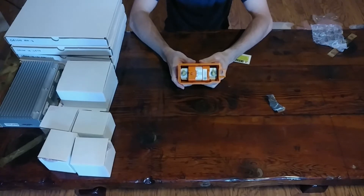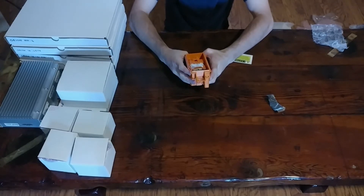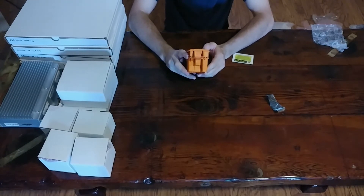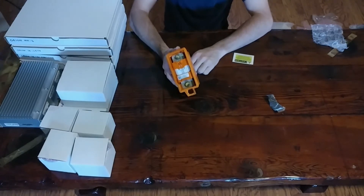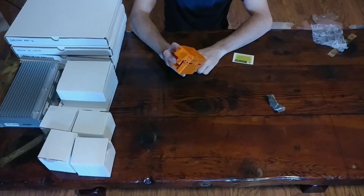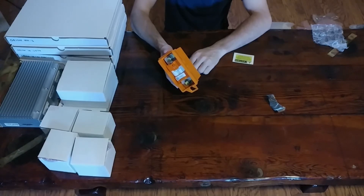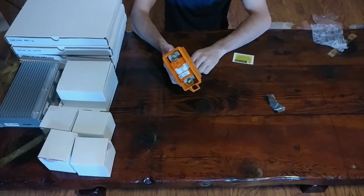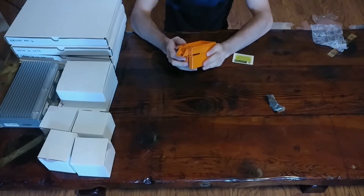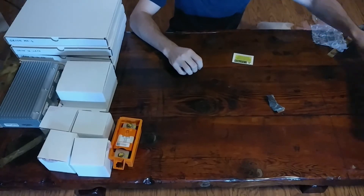This is the main fuse for the battery pack — a 630-amp, 700-volt fuse, which I believe is straight out of a Tesla. I'm not sure what I'll do with the housing yet, but I'll work something out. It will sit somewhere in the middle of the pack, carry the full pack current, and blow if we're pulling too much. At 630 amps it's a little below the motor rating, but should be fine for short-duration full-torque surges. This is the same fuse Tesla uses on similar vehicles, so it shouldn't blow — which would be pretty catastrophic if it did when you're really pushing the throttle.